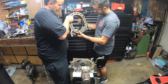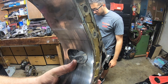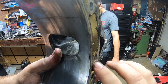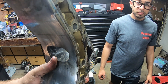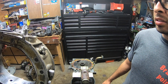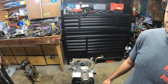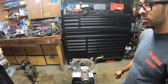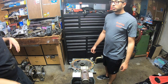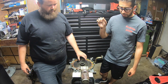This one has a chip in the chrome right here. It looks like somebody when they were porting it ran the bit across the face of it. And I bet that groove is probably because of how they slammed the apex seals into the rotor and messed it up — it wasn't letting the seal move like it should because it was pushed up higher than it was supposed to be, sitting on the corners of that rubber piece.